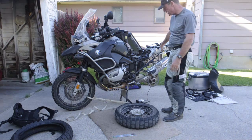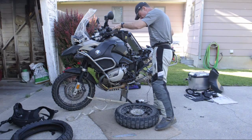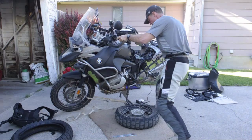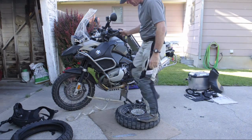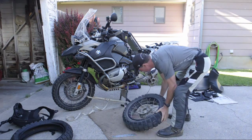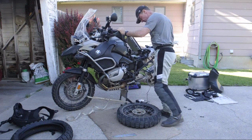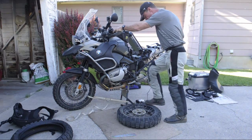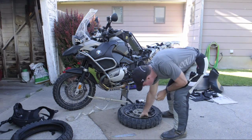We're going to break the tire down now. The R1200GS comes with a built-in bead breaking tool and that works quite well in most cases. That is why you secure your center stand and your front brake — just a little bit of forward movement and that thing will come off of there and you'll be chasing it down the hill or caught under it. People fight these and fight them and it's just really not that difficult to get off with a good technique.